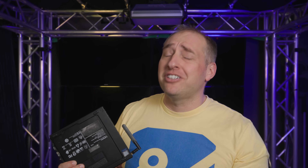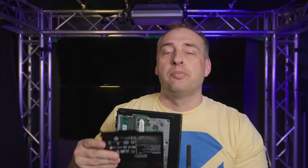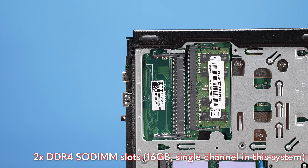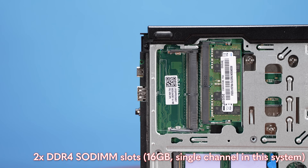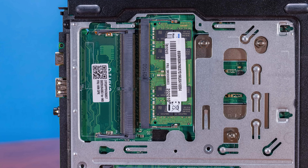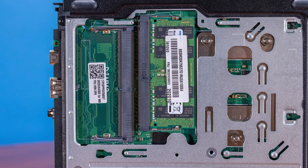Moving to the back of the system, we see the next feature that I really like about what Lenovo does — and I wish other vendors did as well. You pop off the back part of the chassis and you get SODIMMs and your storage. Here we get two SODIMMs. This particular system only had 16 gigabytes in single-channel memory. I always suggest dual-channel memory, so I'll put another 16 gigabytes in this as we deploy it, giving us 32 gigabytes. We've also tried two 32-gigabyte DIMMs for a total of 64 gigabytes.